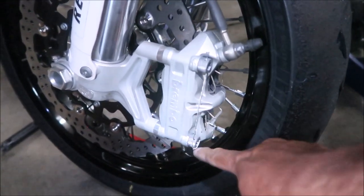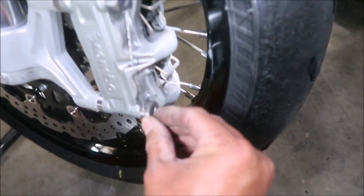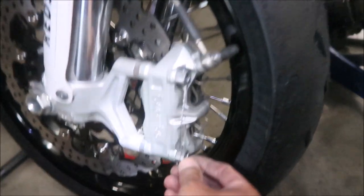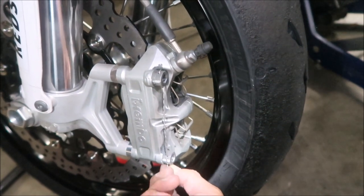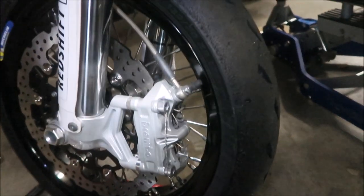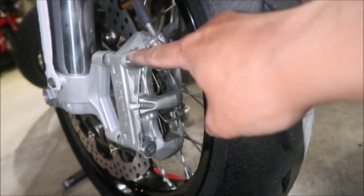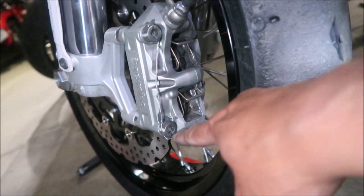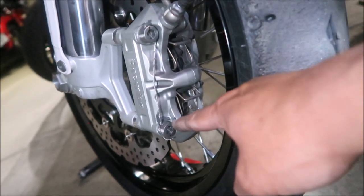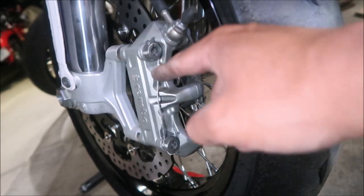So that's the way it works — when you loosen one, it tightens the other. If you have it the opposite way and you loosen it, it'll loosen the other one at the same time. So remember: you want it shaped like an S — going around this way and then that way. Now we just cut it right there, then fold the end in somewhere it won't poke you or get caught on anything.